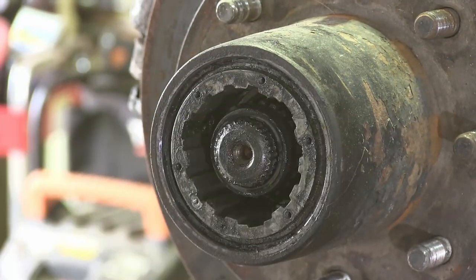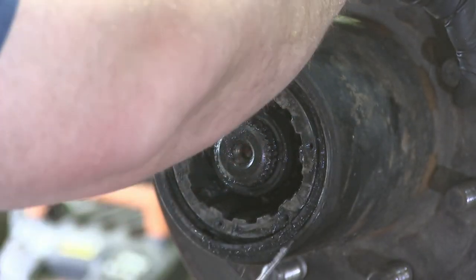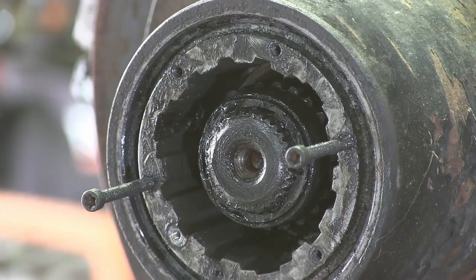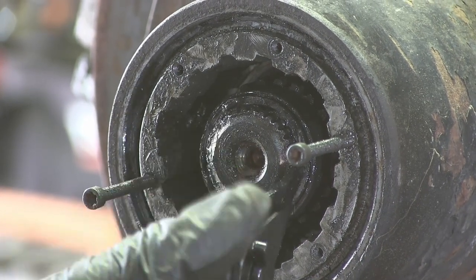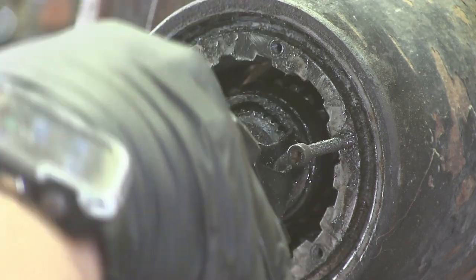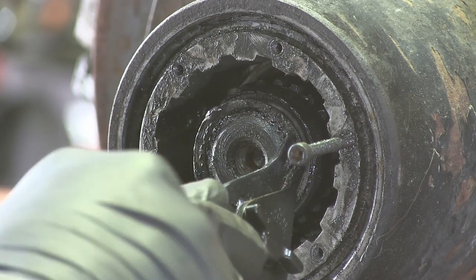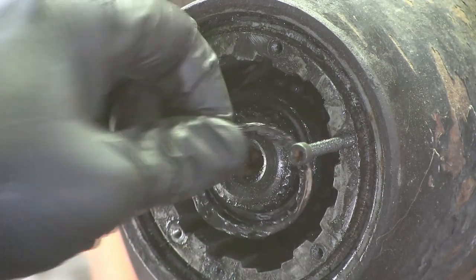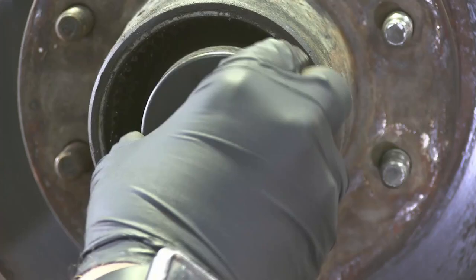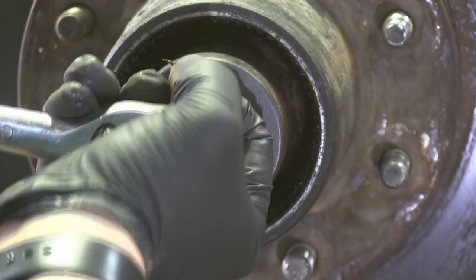Now we need to get the snap ring that goes around the outside. This snap ring should have a notch in the end — use a small screwdriver, get right in that notch, pry it up, twist your screwdriver, and pop it out. Once you get it started it comes out real easy. There's another snap ring inside we've got to get out. Put two of your bolts back in the hub body — that'll make pulling it out a lot easier. Now it's time to get the spindle nuts off with a two-and-a-half-inch spindle nut socket. You'll have a spindle nut, a retaining washer, and then another spindle nut.